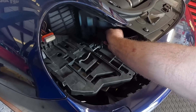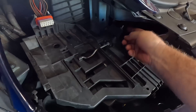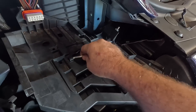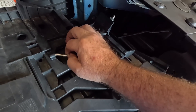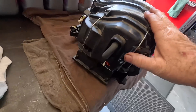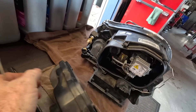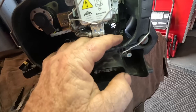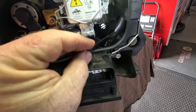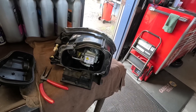The customer with the Porsche is back — the one who tried to force us to work on it right away. The headlight slides in and connects here and you have to adjust this to lock it in place. We put a bulb in it but this wasn't locked in place so I think it was just jiggling. I tapped on it and it turned on, but I'm going to look inside at the socket. Oh look at all that going on in there — the harness is crumbling. So it's going to need headlights — the only way to get those harnesses is to get headlights.